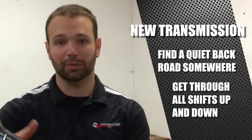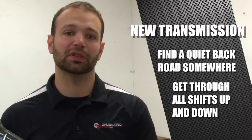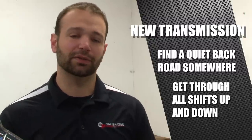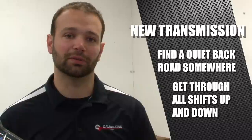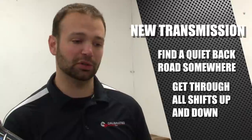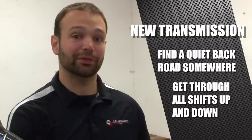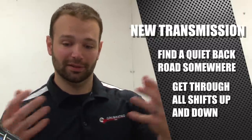Step it up to 75%, then up to 100% until the truck feels clean. Now when the truck feels clean at 100% throttle on the smaller tune, step up to the next tune. Does it feel clean again at 50% throttle? If it does, go up to 100% throttle. Does it feel clean? Then go up to the next tune. You really don't want to put a big shock on the transmission by going to tune five right out of the gate. It's got a big difference between where those trims were at stock to where they are now.